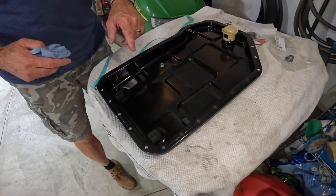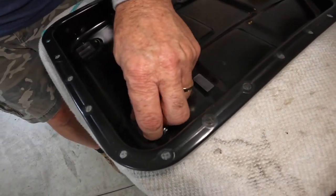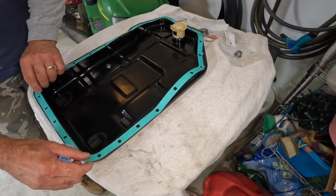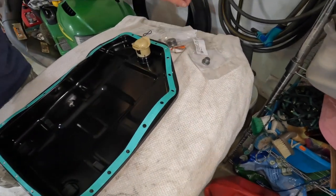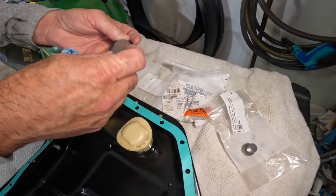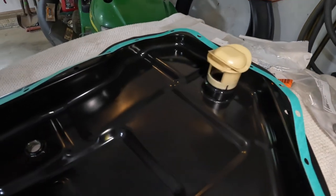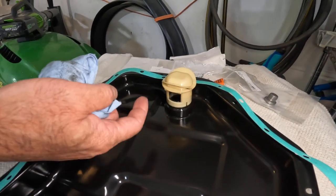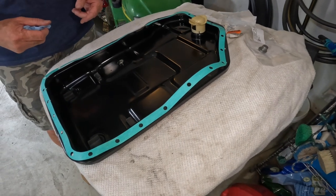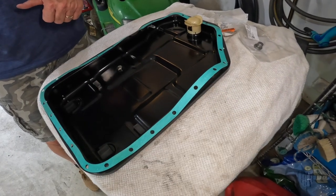We got the pan nice and clean. Interesting thing on these magnets — they are truly just magnets that you clean up and take out. Not overly impressed with this gasket, but we'll make her work. Got the drain plug, the fill plug, and also the rubber gasket for the fill plug. The fill plug mounts right into a little groove there. One thing you'll notice — the fill plug, you're going to come up through it and it's going to come out. So I've got a 90 degree fill plug adapter to fill it up. Right now I think we'll get back under the car and get the internal filter off and replace that. Then we'll put this back on.